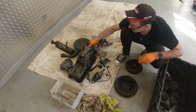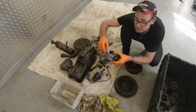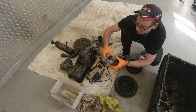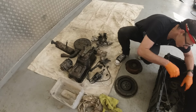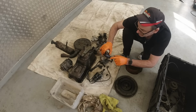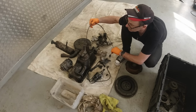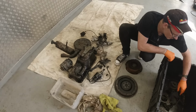Alternator bracket, I think. Water pumps, we're going to need one of them. That's corroded off the end, look. Doesn't feel good either. That's gone. So water pump's definitely needed. Catch can. A new PCV valve we'll get for that. Accelerator cable and bracket. Cable looks good, actually.